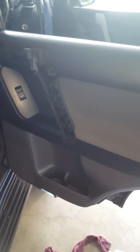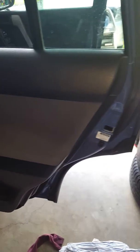Getting the door trim back on took a little bit harder than I first thought. So I actually wound the window down, which allowed me to maneuver the door trim from both sides so that I was able to get in and lever it — not put force on it — but just be able to tilt the door trim to actually get the catchers to hold onto the metal part of that door frame. But it's on now, so basically we can go ahead and clip it all back in place.